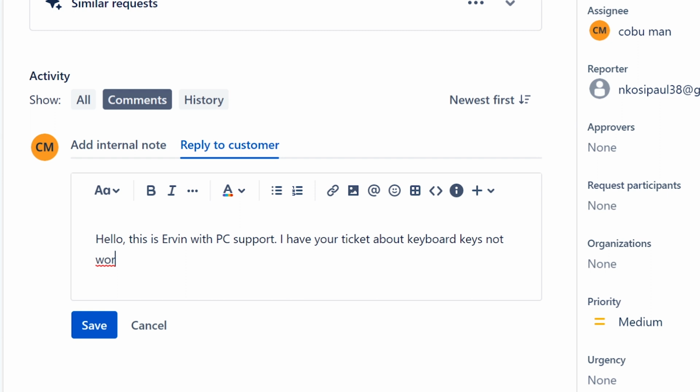I don't want you just to do it, but it's possible to pop the keys off and see if there's something stuck underneath. When you press the key, it has a spring and a connector, and when you push it in, the spring pushes the key back, but underneath it is just a switch. If there's something stuck in between or something dirty, you can possibly clean it yourself. I'm not saying you can't. That's definitely something that you need to look into.